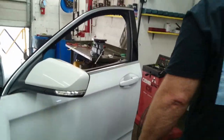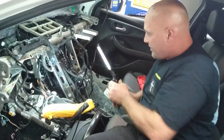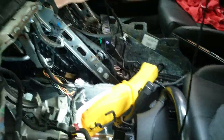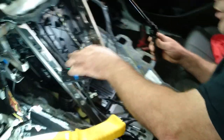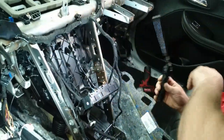It's back together for the most part — I still have to do the wiring. When you're taking all this apart, this right here is part of the console. There are bracket bolts that hold this together and hold up the main support that goes across. There's another bolt you might not notice that you've got to make sure you take off — right here — or it won't come off and you'll pry on it and might break it.